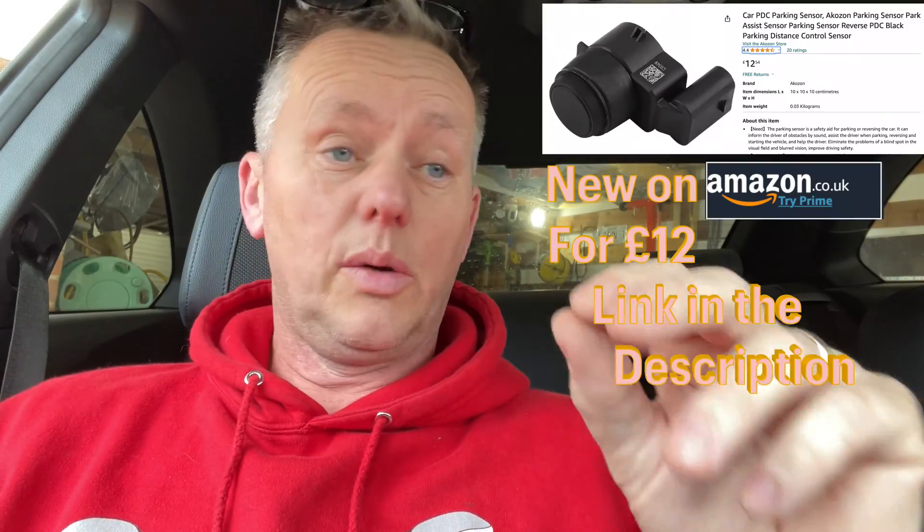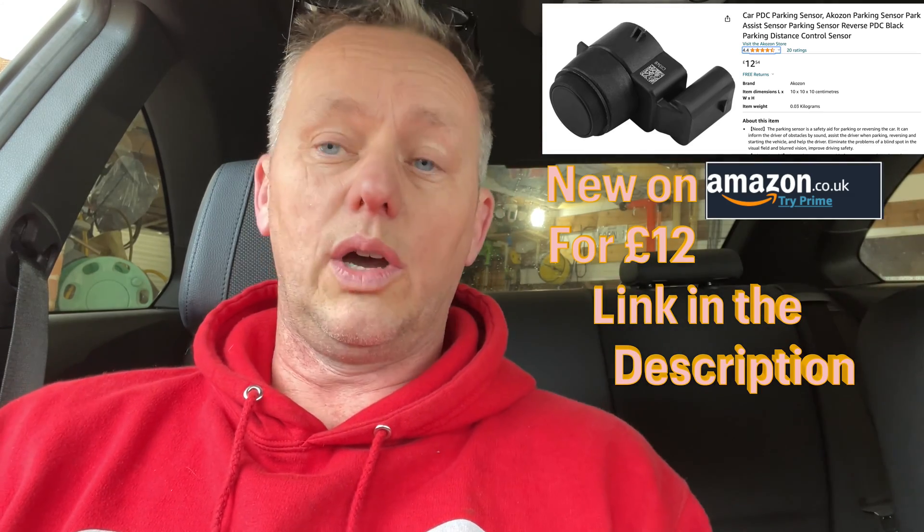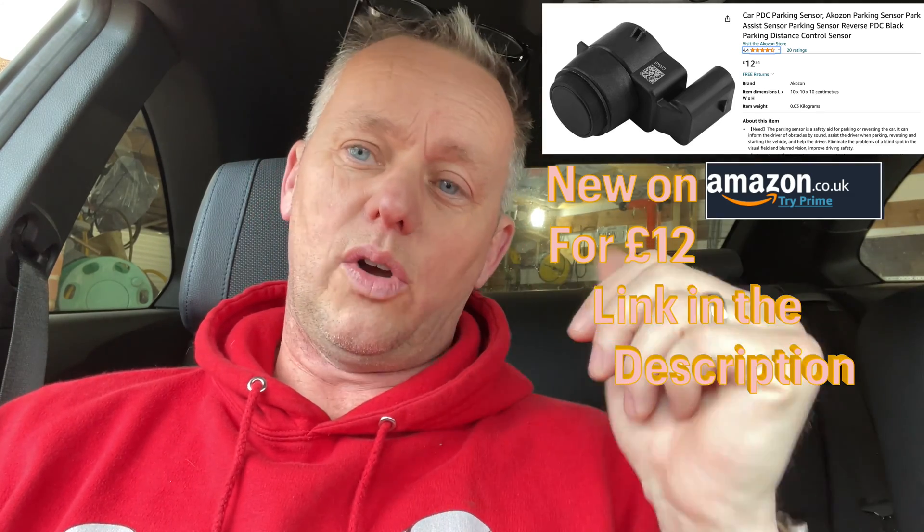That worked out really well in the end. We didn't need to buy that sensor — it was only £15 off eBay so it's not the end of the world, but that wiring trapped behind the bumper beam just needed a little repair. Happy days, all good. If this video has been of use and helped you out — and I probably saved you £15 buying the sensor — if yours says PDC lines, if you've got that fault code coming up, it's most probably going to be trapped behind the beam and worn through. It could also have corrosion because it is above the exhaust and gets really hot. If it's been of use, drop me some thumbs up, drop your comments — always love the comments. Thanks for watching, take care.